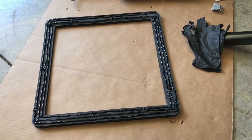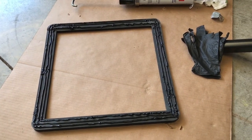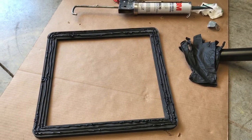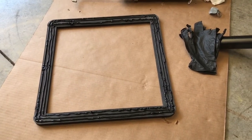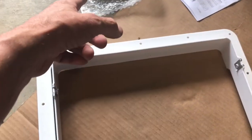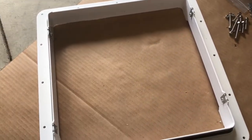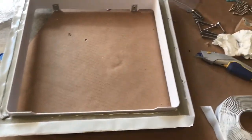It's the quick-set window weld. There we have the flange with the window weld — three beads, press lightly, take your finger around the edge, wipe off the excess. I did tape it so it'll be a clean break; you're supposed to take the tape off within 15 minutes of application. It's been all afternoon, so now we're going to put on the flange using butyl seal tape around the perimeter, then drill once it's set. Two layers and I'll trim the excess.